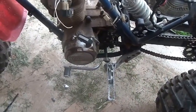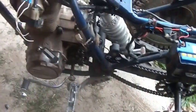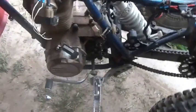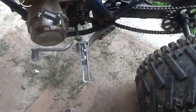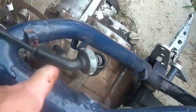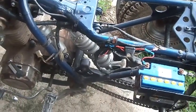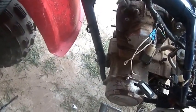What do I have left to do? I need to hook those two up — no big deal. The wire harness is more or less there except for those two white connections. Shifter is on tight. I'm going to put a bolt on each side for the pegs, and mount the carburetor — which might be problematic because I appear to have a spacing issue. It doesn't look like it's going to fit; I might have to change that manifold. The motor just doesn't look like it can go forward much. I'm really surprised I'm having such trouble with the configurations.